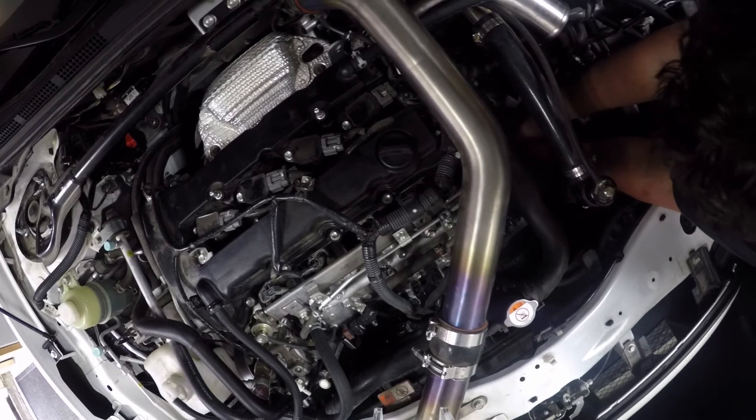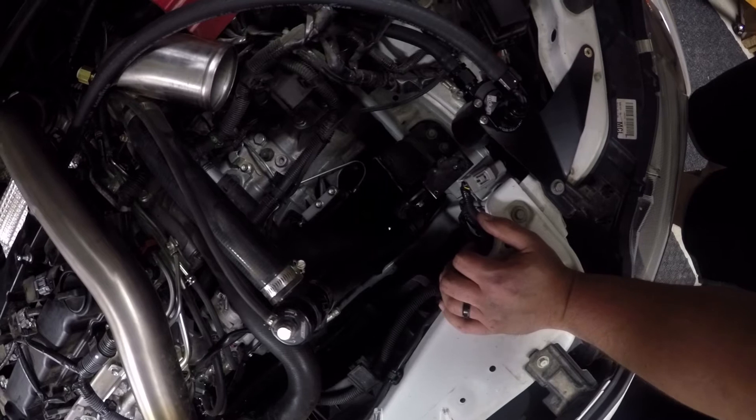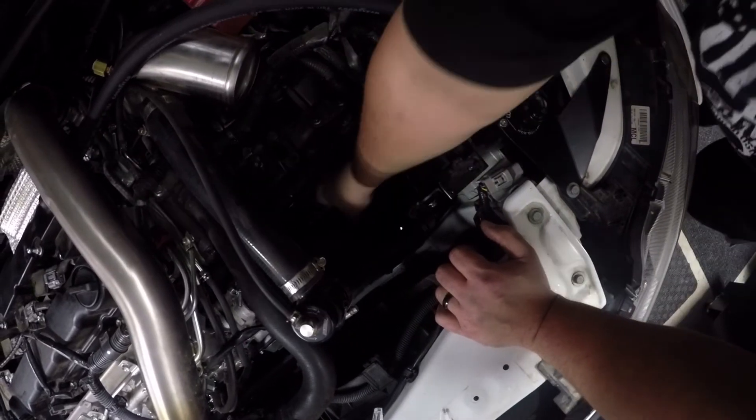The stop itself sits on top of the clutch hydraulic cylinder, and there is a bolt with a lock nut that you adjust out until it's about one eighth of an inch from the shift fork.